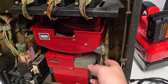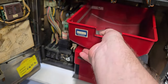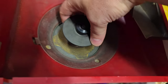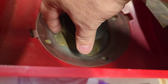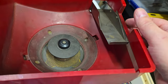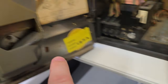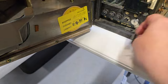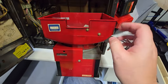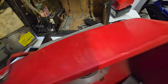Over here is the coin dispenser, which oddly enough I can take out quite easily — it's just that guy right there, and then the coin dispenser comes right out. Inside the coin dispenser there's an agitator right here in the middle, and there is a mechanism down here. It's a little dirty so it's got to get cleaned up. It's got some rubber contacts down there. What it's supposed to do is grab the coins and kind of fling them sideways, they go underneath this ring and come out the front right here when you win. I can get this guy to spin up — it actually does work just fine. So as far as I can tell, it just needs cleaned.